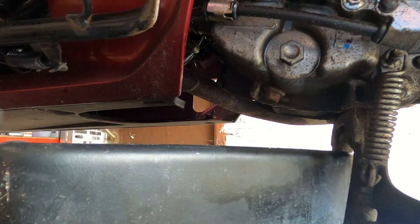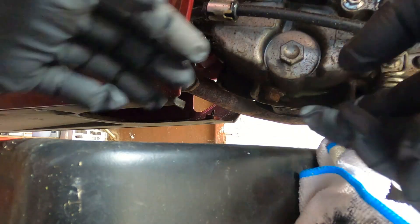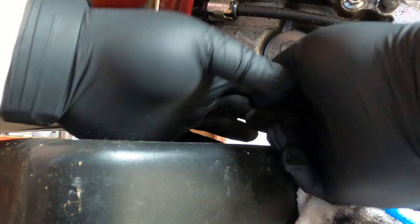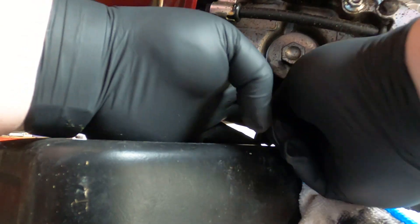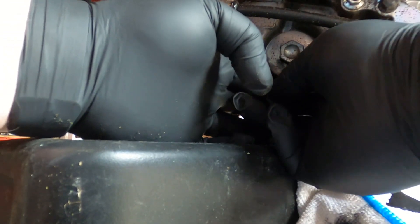Because there's no oil filter on these 125s, you know, which freaked a lot of people out. Getting this ready just for any spillage. So I'm gonna get the drain bolt out and we will try and catch the drain bolt as well. Let's see if we can make this look professional - first time for everything, eh.